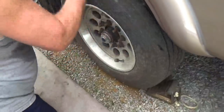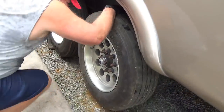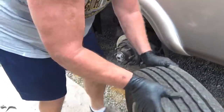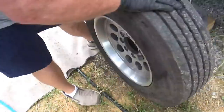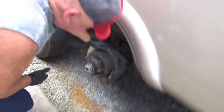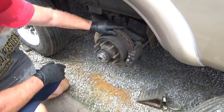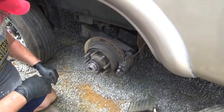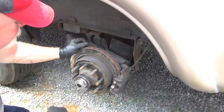How's that one doing? It's dragging. That's dragging too — not good. How's that look inside there? Well, the weights are still there. Oh, that's good. These pads are worn. Uh-oh. You got a cracked rotor? Cracked rotor. Where's the crack at? Right there — the band right here. Oh my gosh. Why's it got two cracks in it? Heating up. Oh crap. Now what?